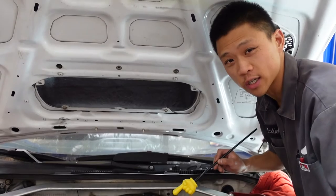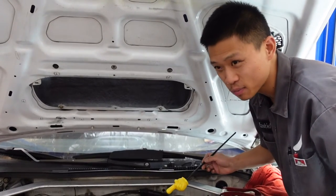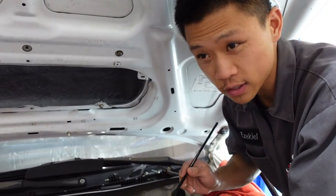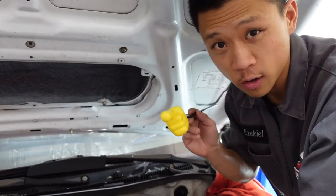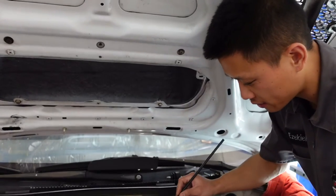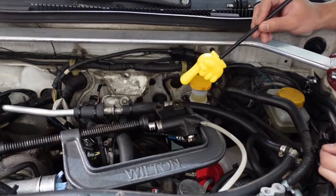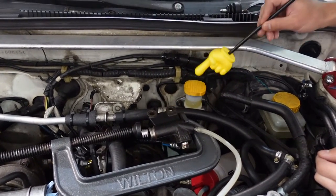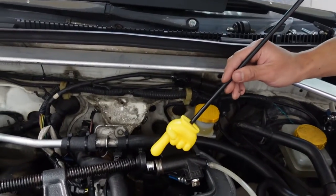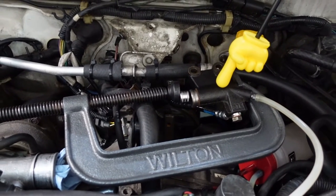After hours of frustration trying to bleed this clutch last time, I thought to myself, have I not done this before? What am I missing? I watched a ton of YouTube videos, saw a few forum tutorials — I want to say you should throw all of them away. This is the proper way to do it. Just like the service manual says, we have the clutch slave cylinder unbolted and in the highest position. Because air wants to rise, we put it higher than the clutch master cylinder. I took the pin out, we have a deep eight millimeter socket, and we have this slave cylinder completely compressed.